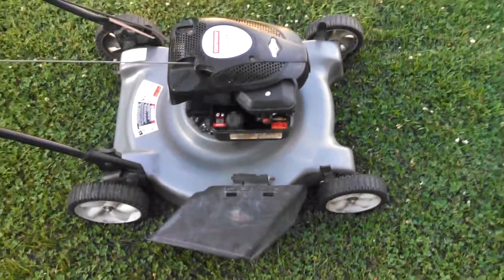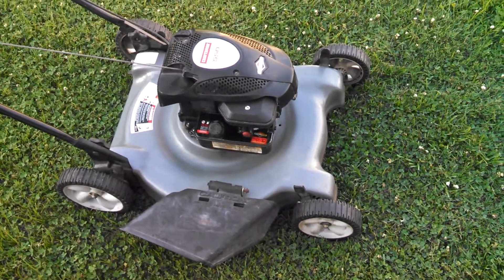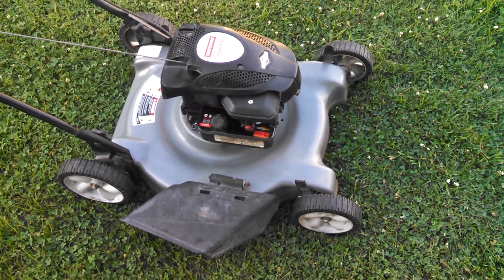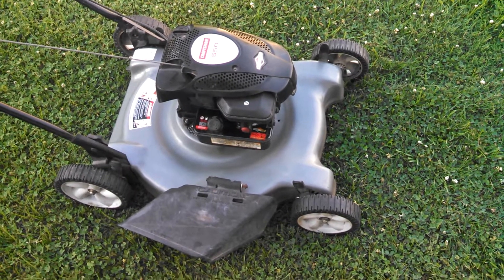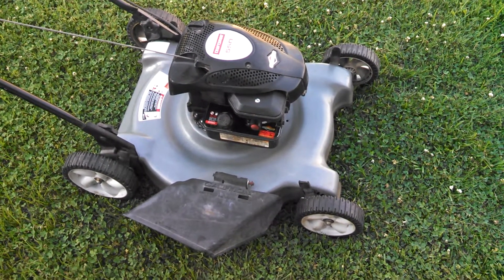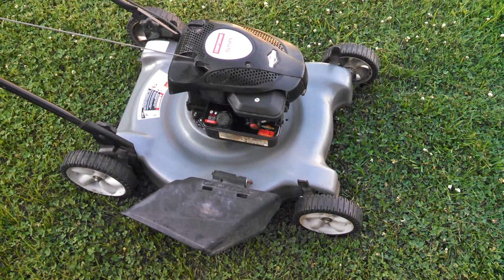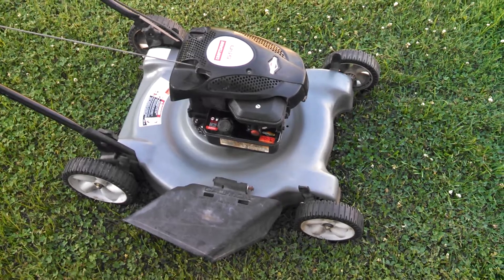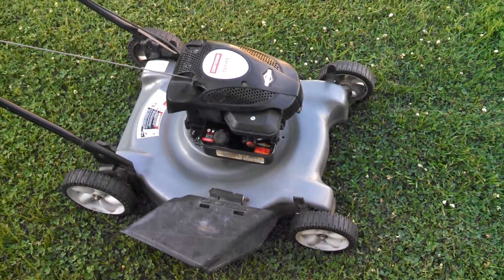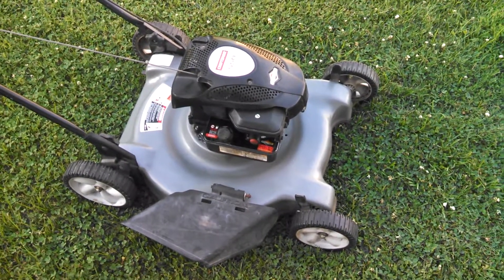I think this is going to be a good mower. With trade-ins, you try to clear them — I made $25 on the mower and got this one. I've got a $5 carb kit in it, and a fairly new plug that was carboned up from running too rich with the bad diaphragm. So I've got a $5 diaphragm in it, about a dollar twenty-five worth of oil, and a little soap and water. I've got a little over $6 in it total. It ought to bring me some decent money — I'm going to ask $50, take $40.